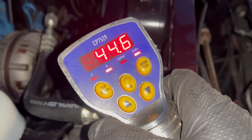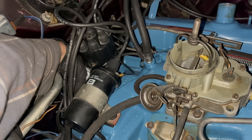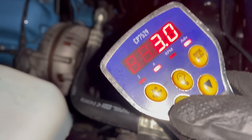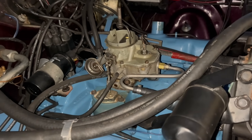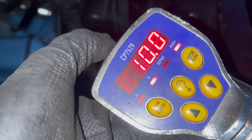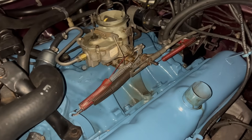There's like a 30 or 31 degree curve in this distributor. Things start to make sense when you learn that the factory timing spec is actually 0 degrees, plus or minus 2 and a half. I really don't think that's what this thing wants in life. 3 is like 2 and a half — the spec being 0 plus or minus 2 and a half. No, it doesn't like that. Part's out of the car with it set there. Of course, we don't know if the timing mark is even correct. It seems pretty happy here if what the gun says is 10. It's gonna be a lot of timing on top, especially when you consider the added vacuum advance, but I think I'm gonna drive it here and see what it does.